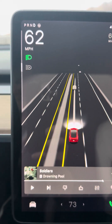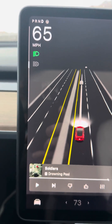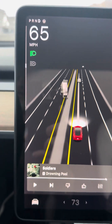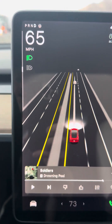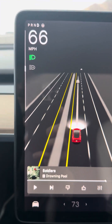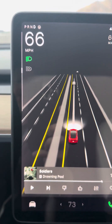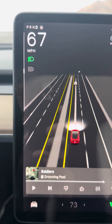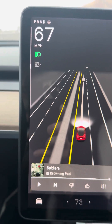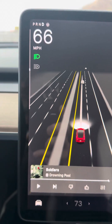If you ever see dots on the top bar, usually your state of charge is so low that it doesn't pull as much power out of the battery any longer. I'm trying to think of any other reasons why you'd have dots on the top. But it's mostly just if your state of charge is so low, or if your battery is so cold, that it will do that to protect itself. That's when it limits the regen — it's protecting the cells. It does a lot of damage to a battery if you're charging it at a very, very low temperature, usually below zero Fahrenheit.